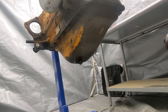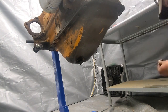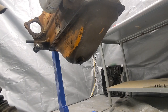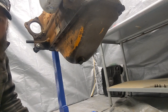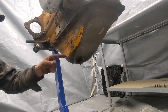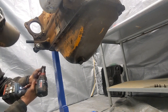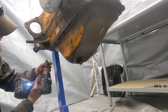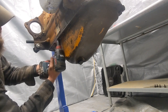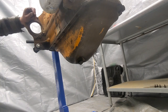We need a half-inch socket or wrench - probably the socket. I'm removing this while the engine's still right side up because I suspect the bottom's going to be full of all kinds of crap in the pan, so we can catch all that and look at it. Looking at the top side of the engine, it looks like my rings may have been going - pitching rings - so I don't know if I'll find bits of them in there, but I know I'm going to find a lot of bearing material.